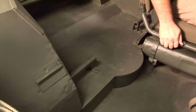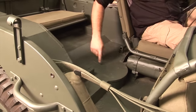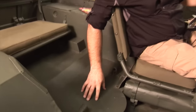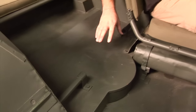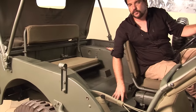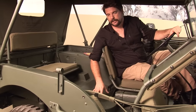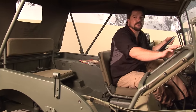One of the best things about this vehicle is right here — this is where your machine gun is going to mount. That's why this area is bowed out: to accommodate the plate that's under here, where the holes are for your .30 caliber machine gun mount. When looking at the difference between an MB and a GPW, this plate on the actual frame is different — the Ford GPW is more of a square frame, whereas the MB uses a more round plate.